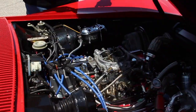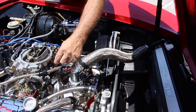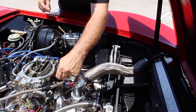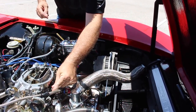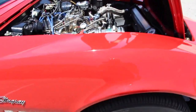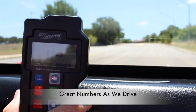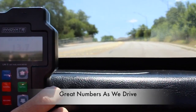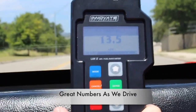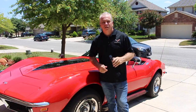Now I'm going to go ahead and adjust the two fuel air mixture screws just slightly and see how that affects the meter as we continue to drive. After the final adjustments, we're getting the high 13s and low 14s on the meter. With that, it looks like our work is done here. Very good adjustments.